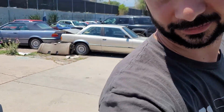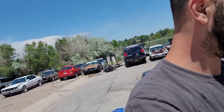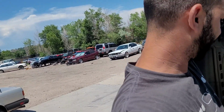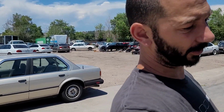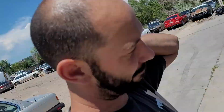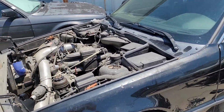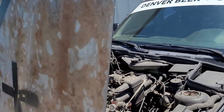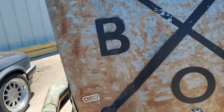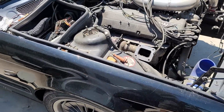If you're not from our channel from way back, we turboed this car for a Roadkill event, the Zip Tie Drags, and we spectacularly blew it up the night before we were supposed to leave. We made it down there, it's in Tucson. We took it down there and then promptly put a new head gasket on it. That's what blew. We lifted the head, and it had bent rods when we were there. We thought about swapping the engine, but didn't end up doing it.